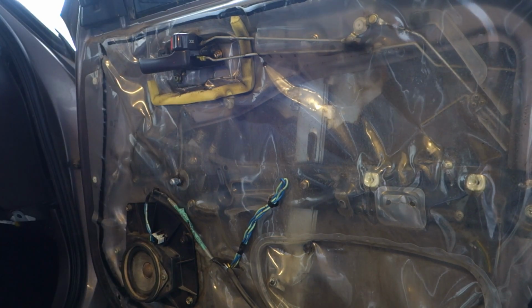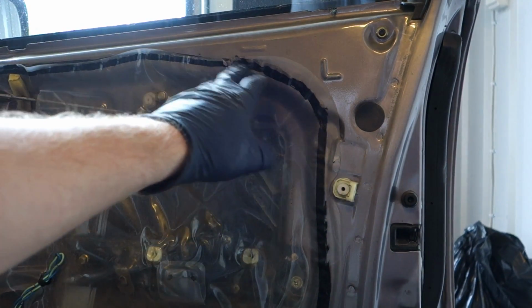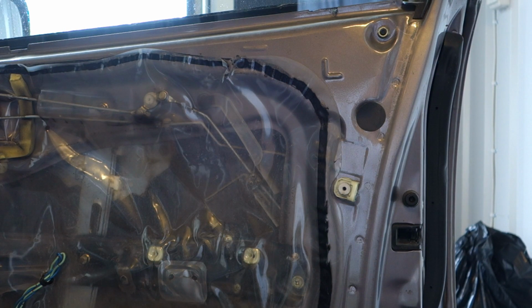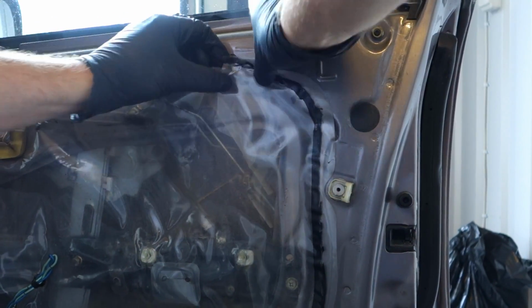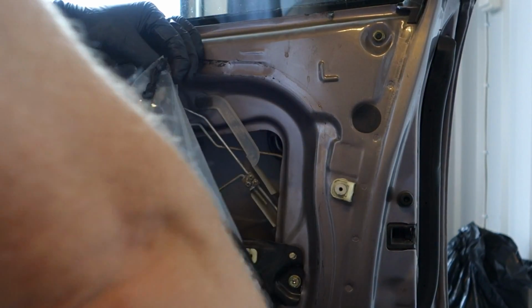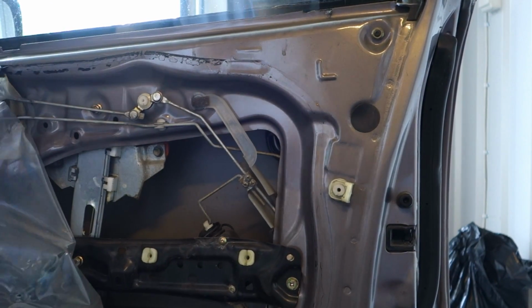Okay, and when I am planning to replace this lock, I can look at my door, and then I need to take this plastic cover film away a little bit, but be careful that you don't destroy this plastic, because it is very important. It is humidity control, so we take it out carefully, and actually if it gets broken, we can use new glue in here. And now I take that out this way, and more in here.